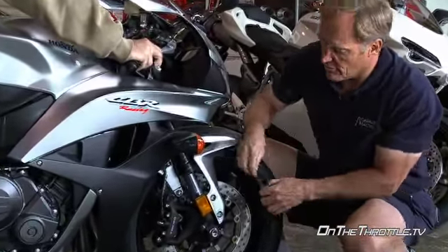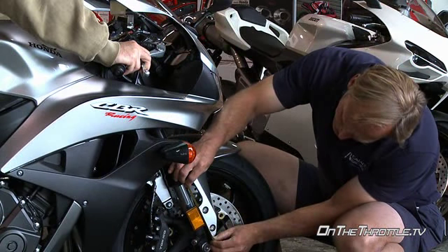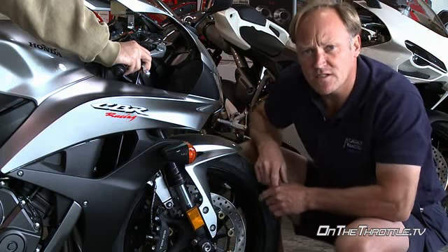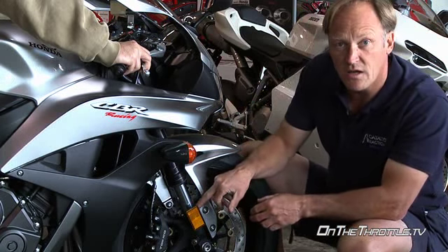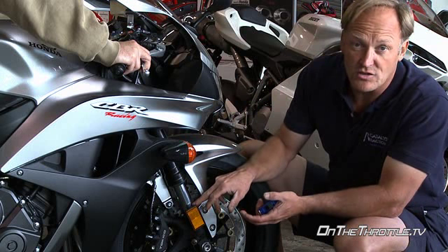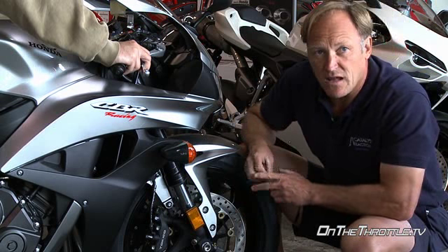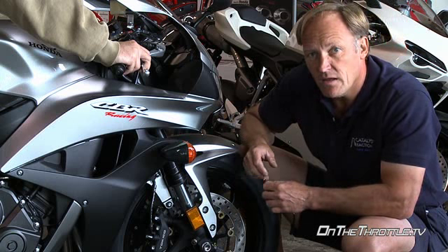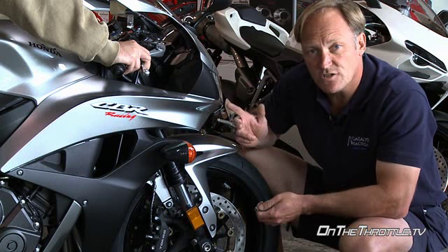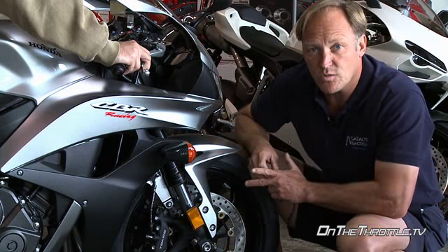In the front we know extended it's 140 millimeters, and with Dave on the bike he's at 30 millimeters. Given that we're losing 25 millimeters of travel, and then effectively losing another 20 millimeters on top of that, if we subtract that we can see that the front end is rigid. So modifying the front forks is essential — changing the fork springs if you're this weight is also essential — but the back of the bike will work perfectly.